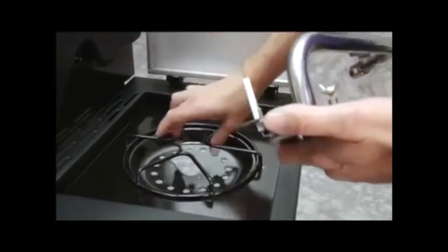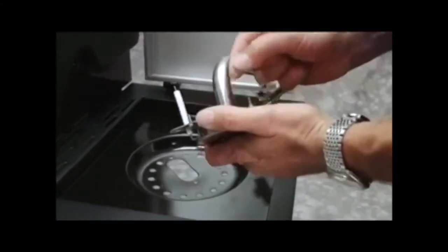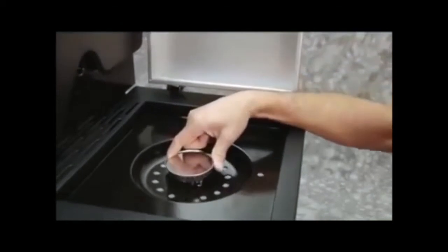To install the side burner, remove the pre-attached nut and M4 washer on the side burner. Attach one M4 bolt to secure the tip of the side burner. Attach one M4 by 10 mm bolt from the top of the side burner to secure in place. Now attach two M4 washers and one M4 nut and one wing nut to secure the side burner.